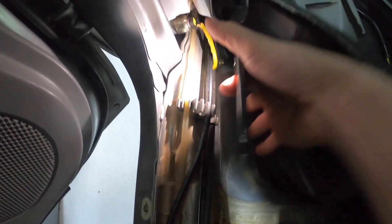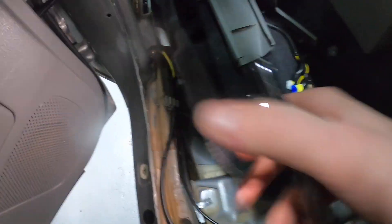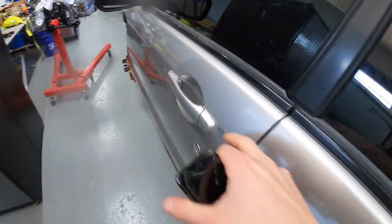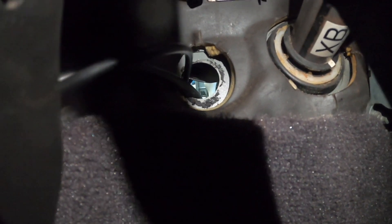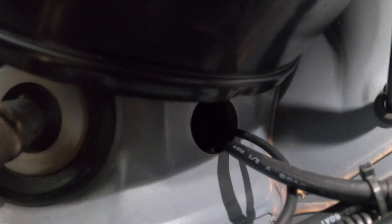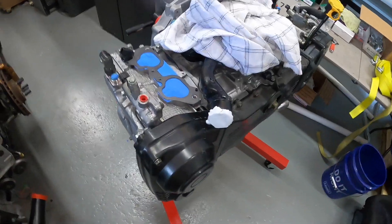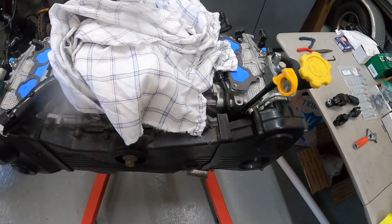The lines are going to come through where the stock fuel line comes through anyway - I took the grommet out and put some sound deadening just to protect the sharp edge. They'll go right behind the carpet, in line with all the stock fuel lines, all the way to the front. Then they'll go through a hole right there, nice and discreet, and come out up under the dash - you can see it from there. They'll come right out of there, go right over to the top of the engine to that Y fitting, and straight to the fuel rails and on to the regulator.